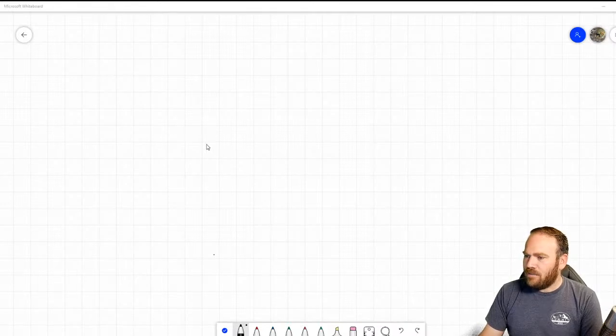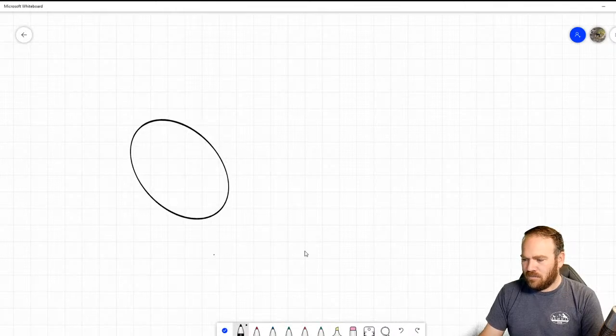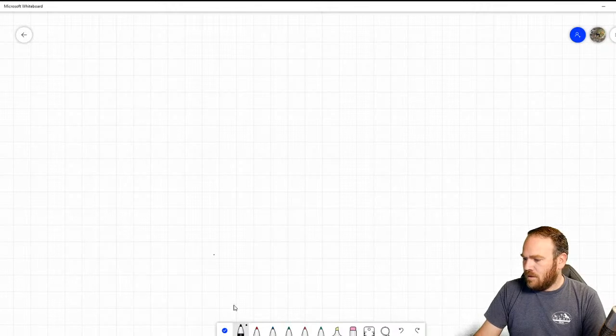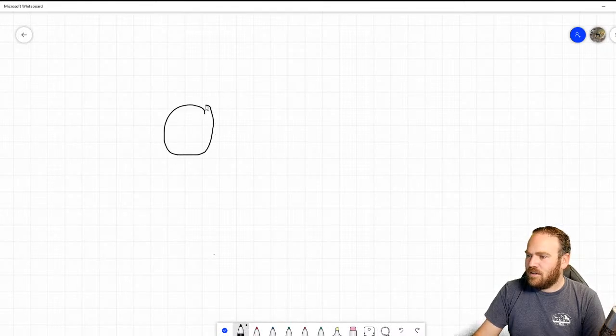So when we have a throttle body, it's going to be a DC motor. Now, I know that because the polarity switches, it may seem like an AC signal, like the current's flip-flopping, but it's not. Let's draw a circle. We don't have it. Using stuff I'm not very good with here. There we go. It corrected it for me. This is just a DC motor. This is a throttle body.